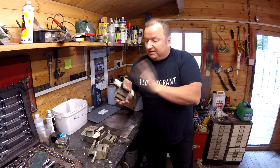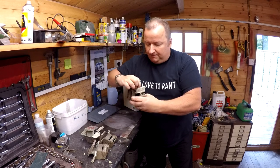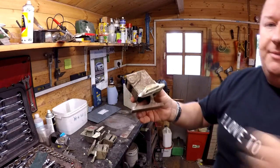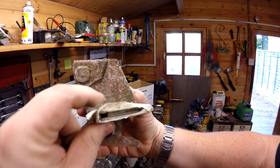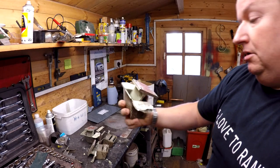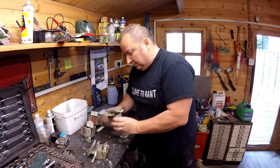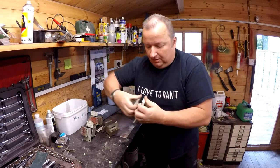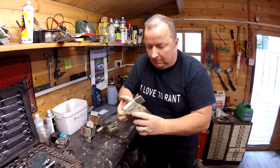These things also come with shims on them. I don't know whether you can see them here but I'm not going to take them off. Underneath here some of these had shims — this one had three shims for example — and I've left them in the correct order. So this is the bottom right hinge on the right hand side, top left there, top right, and bottom left. They are very stiff but they should be recoverable.